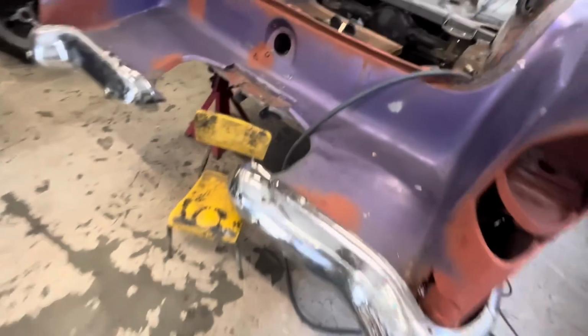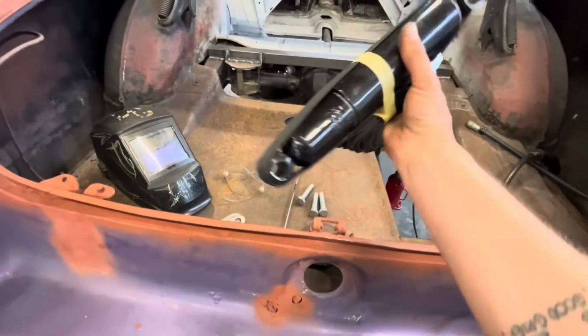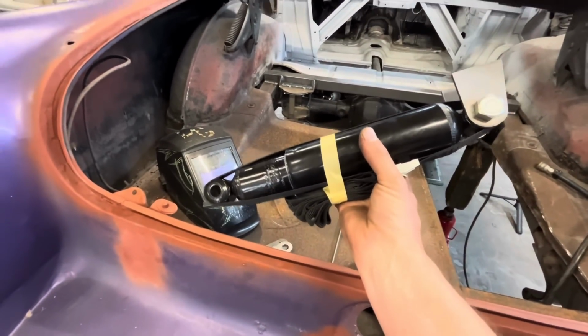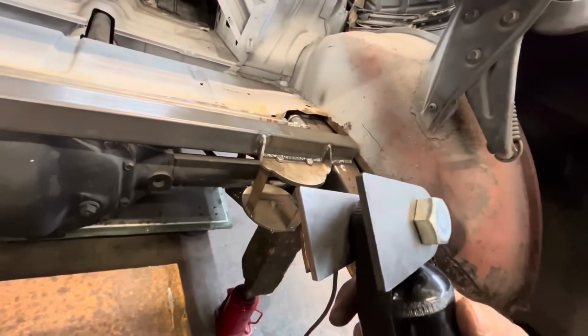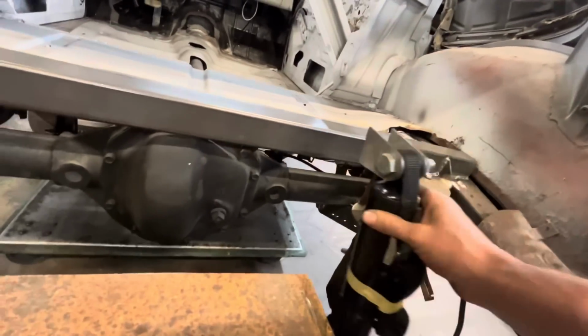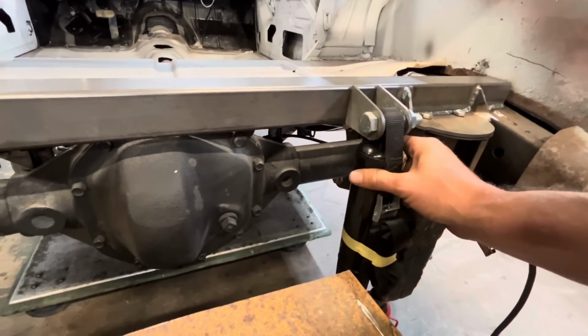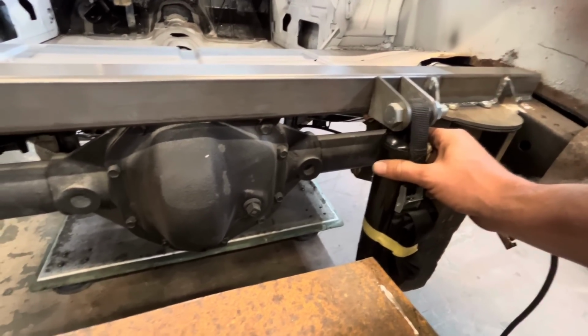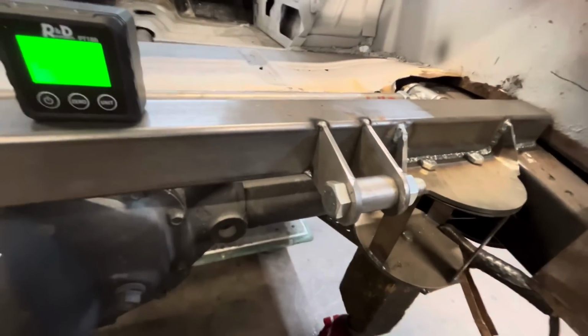What I've done is taken a little strap, and I've sucked this guy as short as it will go, and I've cut off 2 brackets here. These brackets are 2 inches, so they should fit perfect on our 2-inch tubing. Like that. We'll tack this end on, and then from there we can figure out how to get the bottom end attached to the rear axle. Just tack these guys on.